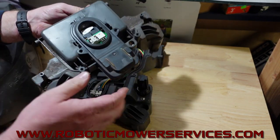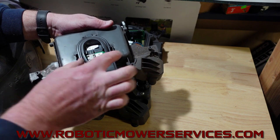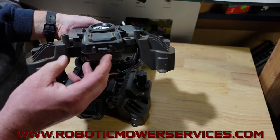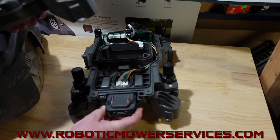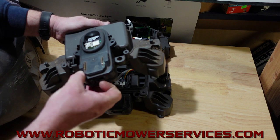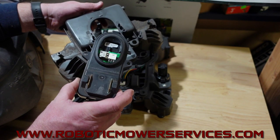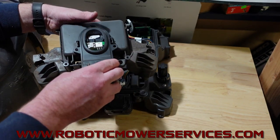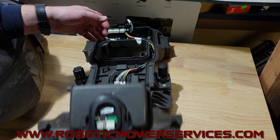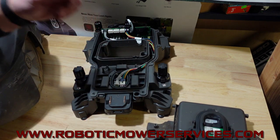This is what comes out — you can see the little nubs I'm talking about, and that's the tab that releases it in the front. This board has two screws in it; there's supposed to be a clip at the back — this one broke off — and you have the clip at the front which is intact. You take the two screws out, pry out at the front, push back on the clip at the back, and that's the whole unit right there. To replace it, just reverse the process: put the new one in, clip it in the front, clip it in the back, put your screws in, slide into the chassis, flip it up so it latches with the tab, put your screws in, and connect your wires.